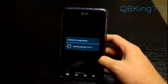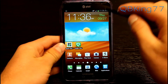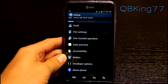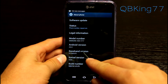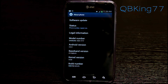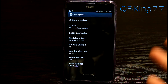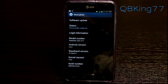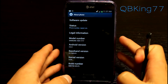It'll take a little longer to boot since we wiped the cache, but the Note has booted back up. Let's verify the modem installed correctly: go to Settings, About Phone, under Baseband Version — you'll now see UCLF5 instead of UCLF6, so we know it installed successfully. I recommend running through and testing it yourself — I can't tell you which is best since I haven't fully tested all of them. Test them all and leave a comment letting us know which modem runs best on your device, as it differs per device.